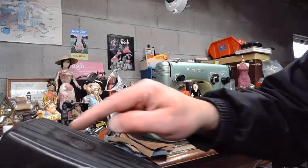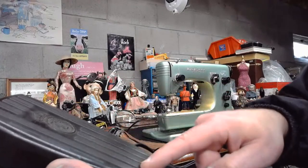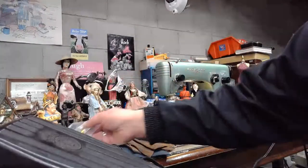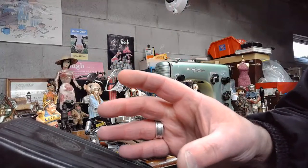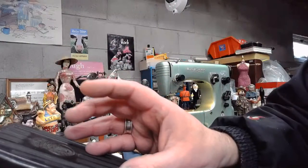And inside of here, before that rheostat can do its job, there's a capacitor and a resistor like these that will either retard the amount of voltage that can go through, or store it temporarily and then feed it slowly into that motor.